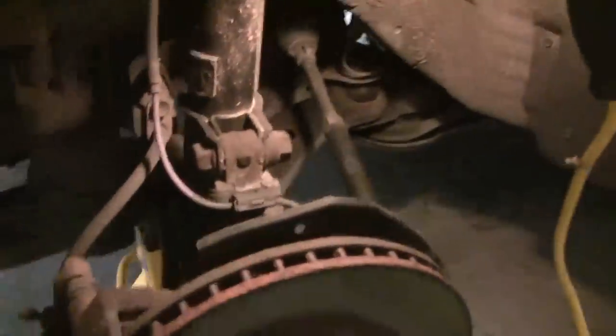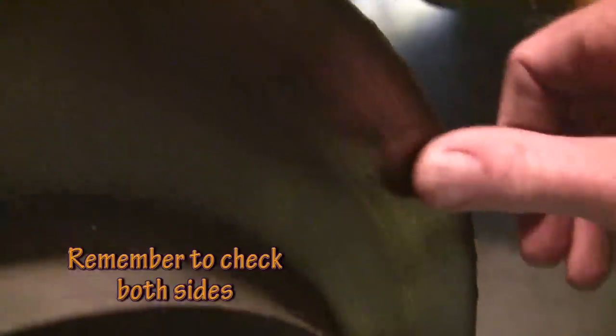First thing you do is have a look around. The struts are fine with no leakage. Similarly, the CV boots on both the inner and outer look fine with no leakage or tearing. There's no leakage around the brake bleeder nipple. More importantly, I'm looking at the status of the rotor — and not unexpectedly given that this is a hybrid with not that many miles on it.